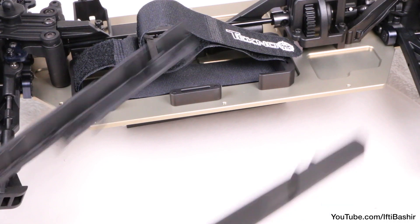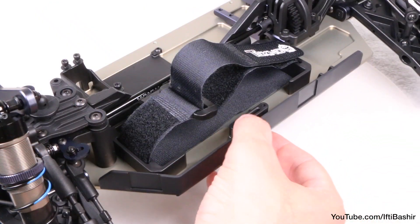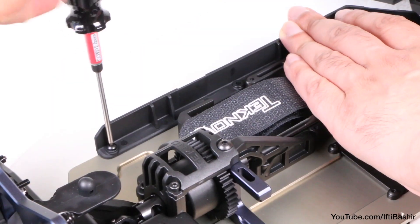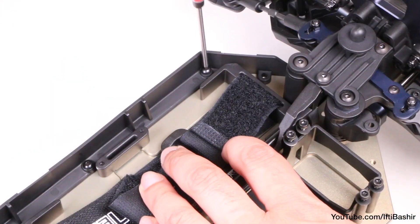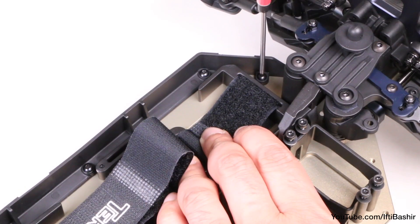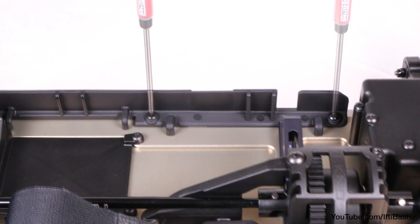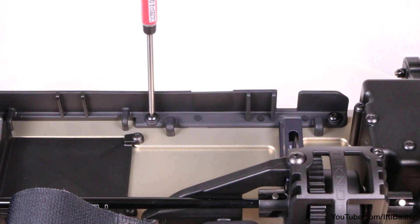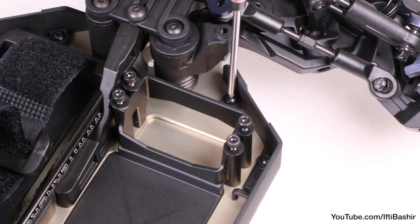With the battery mount down we'll move on to the side guards. The first mounting to the left side of the buggy with four 8mm button head screws feeding in from the top — add some thread lock as we're going into metal. After which we repeat the same on the right side of the buggy, albeit loosely considering we'll be using the cable management guides when installing electronics later.